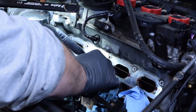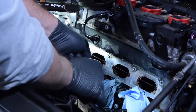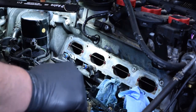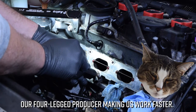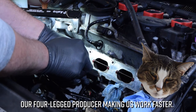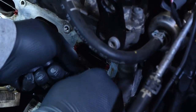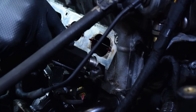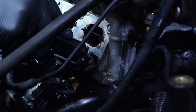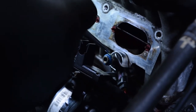What I'm using here is the tool for installing the injectors and getting them pushed down into place. There's a very specific position they need to go in — it's about a five o'clock position on the head so they can accommodate the electronic connector. They were easy to put in; it was just a really good firm steady push. A little bit of clean oil on those o-rings so we don't have any chafing when we go to install.